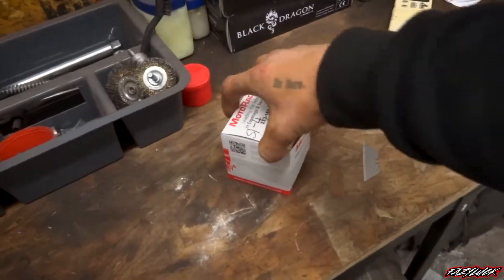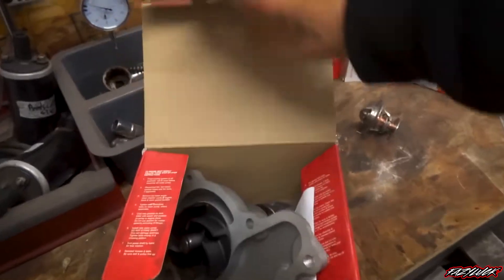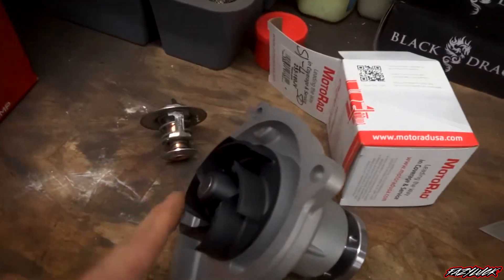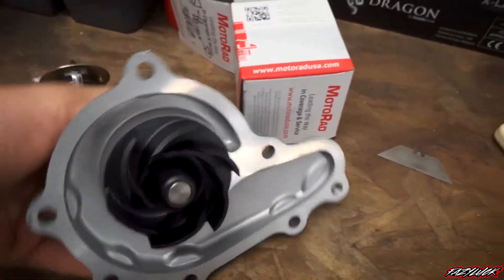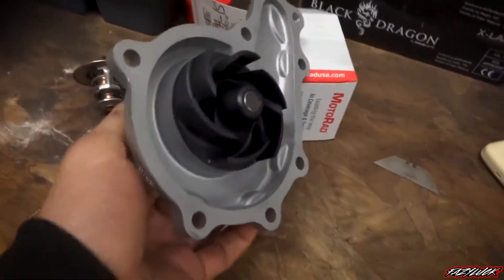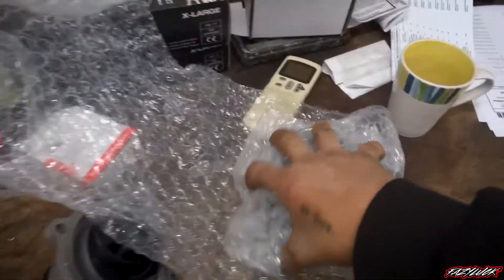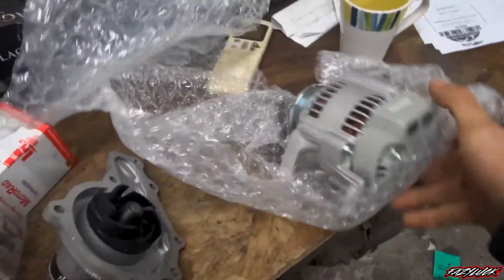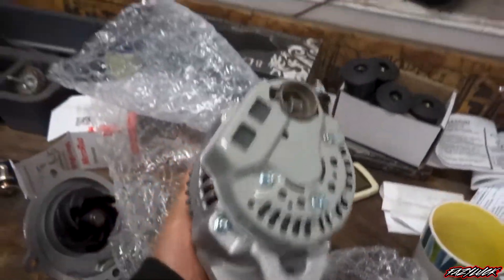As far as the mechanical stuff goes, it wasn't charging properly and also got hot at the wedding. So I've got a low-temp thermostat for it, and Green Brothers bullet impeller water pumps — they use brand new GMB water pumps and swap their bullet impellers into them. These are way better for cooling efficiency and lower cavitation at high RPMs compared to a factory one. I also got a new alternator — it's actually a nice small unit I believe off a Suzuki, only 50 amp, fits the factory 12A mounts, and it's nice and small and light.